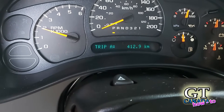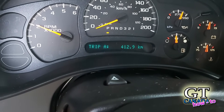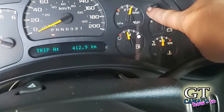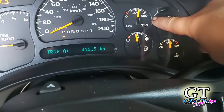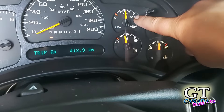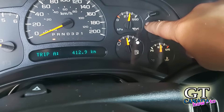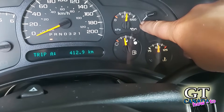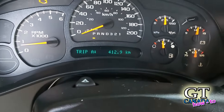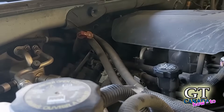Start it up and run it to about 2000 RPM for at least a few seconds. This allows the oil to work through every part of the engine and fill up the oil filter. You should also keep an eye on your oil pressure gauge — make sure you have some; if you don't, that's a problem. On Chevys this is a real gauge; on Fords it's a dummy gauge driven by a switch. You can see the pressure changes as the engine idle changes — that's a good thing. Now we'll just double check the oil level, and it's great.